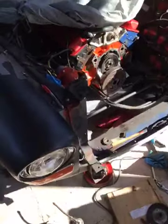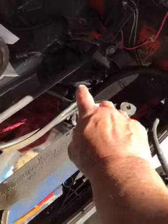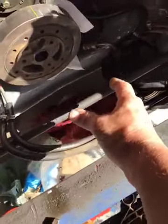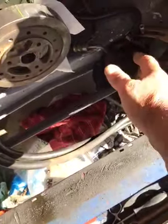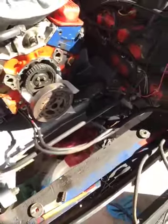When I took it apart - see, the power steering pump was down underneath the anti-sway bar when I put it in. So I had to remove the pulley so I could get the power steering pump up, and the harmonic balancer fell off. And I'm like, what the hell - and it was wallered out. Wallered out bad.